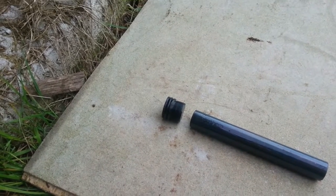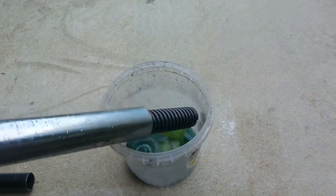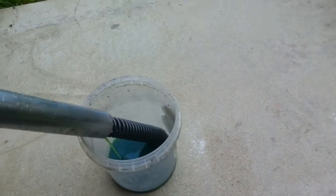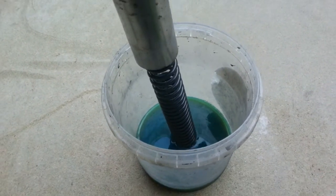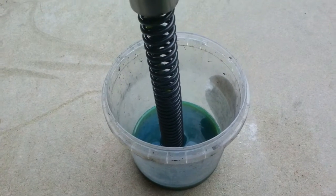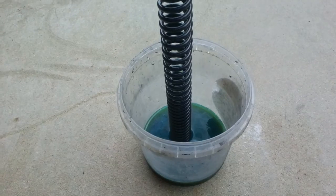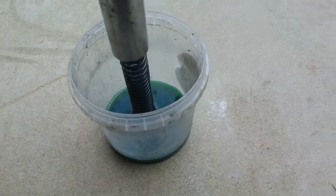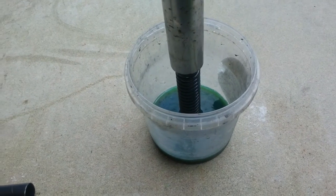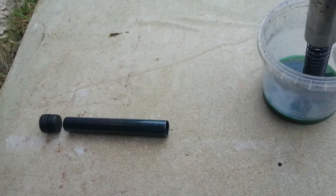So that's the little top piece that came out, and then there's a spacer. Just going to drain the oil into this tub — don't know how much is in there. The oil looks pretty dirty. That's the spring. I've never done this before, I've never touched a fork before, so we may have a couple of hiccups. That's running off. I'll take that fork out and that spring out, and we'll go from there. Going to align everything on here the correct way so we know which way it goes back together.